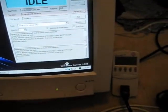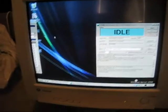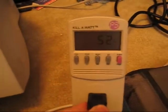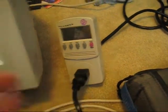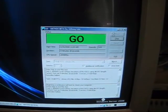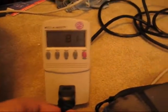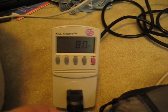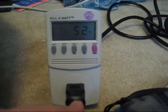Now I want to show you some real crazy power consumption numbers. This machine running stock — you can see it's pulling 51, 52 watts from the wall idling. Now what I'm going to do is use Orthos to ramp up the CPU and stress the system; we'll watch and see how the watts increase. That brings us up to about 81 watts with the CPU going full speed. So, 81 at full load and about 52 at idle.